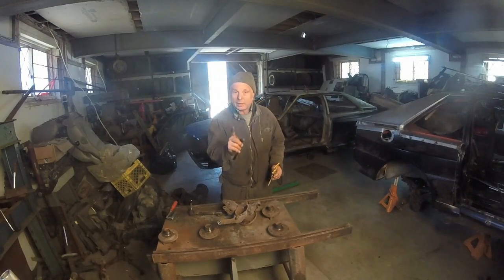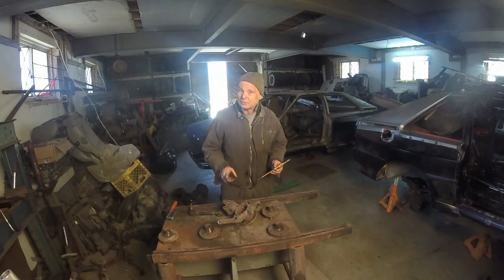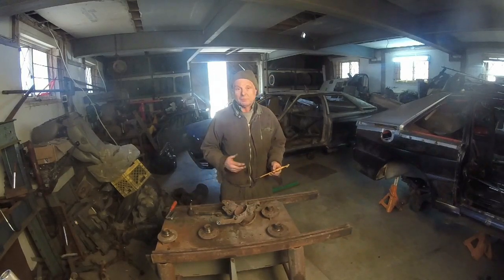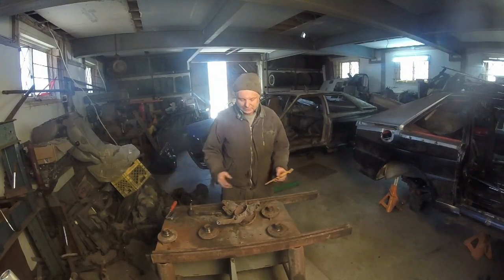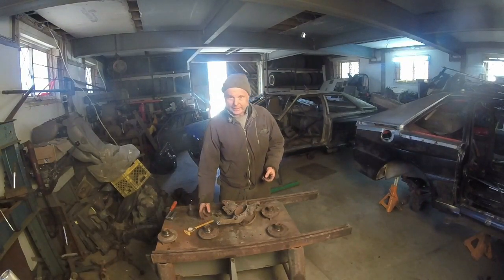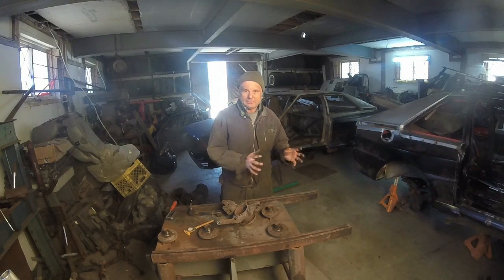those new hubs. We're not going to use new bearings, mind you, because if you put new bearings in there and you run it around without the CV shafts, the bearings get destroyed. For some reason they do. I don't know why. Everybody always told me that. I never believed them until I did it, and then one of my bearings went in like 2,000 miles, and they were new bearings. I'm not going to deal with that. So I always use old bearings. Get it done. Get everything set up, because who knows?